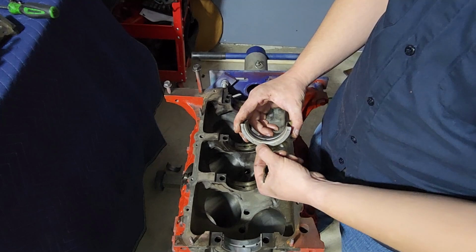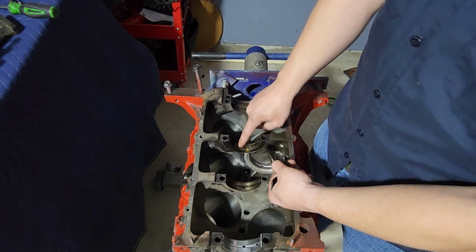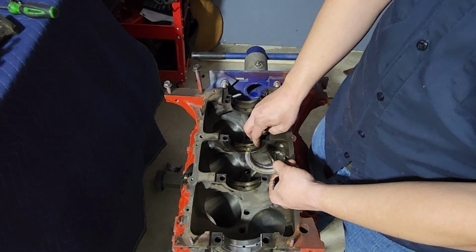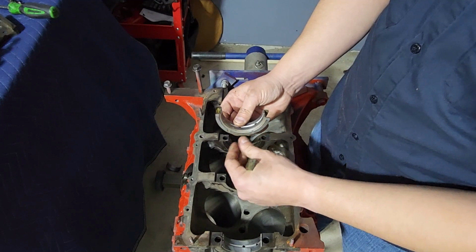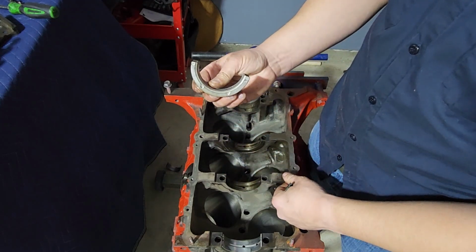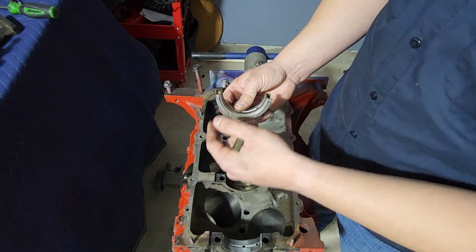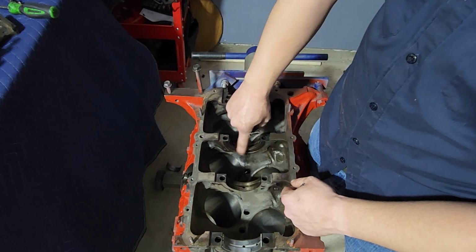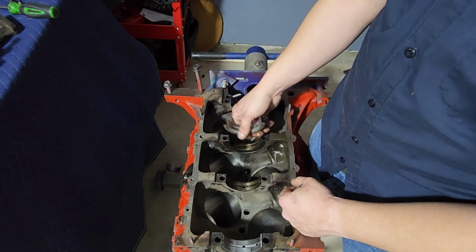And part of the crankshaft needs to ride somewhere that isn't the block, because if it does, even if the block were perfectly machined for it and very nice, it would eventually wear out the block and you wouldn't be able to add anything to it. But if you make a bearing with that, then the crankshaft can be pressed into this. You can change these bearings. You can potentially change a crankshaft if it's worn out, but you're not going to have to throw away a whole block, because like this lip here basically got burned into it by a crank. And you can't put anything there now.